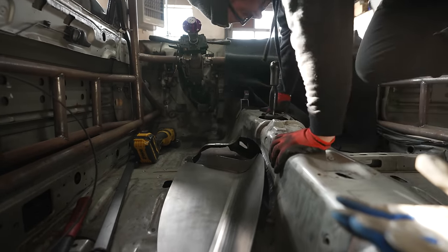We're going to take this sweet clutch pedal reinforcement from GK Tech — it's a well-made piece of metal ready for welding — and weld it into our clutch pedal bracket. If you grab that pedal and wiggle it left and right, it's not a very strong piece, and once you do any serious clutch kicking it just bends into a pretzel. My five-year-old twin daughters came to the shop to cause havoc and eat pizza and helped me assemble this GK Tech brace. Zach has that GK Tech brace welded in — now we can absolutely monster mash on top of that thing and it won't distort at all.